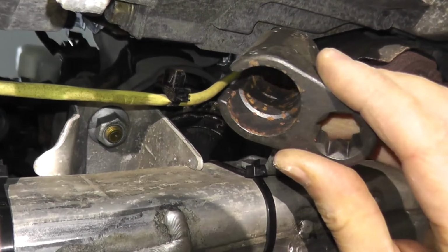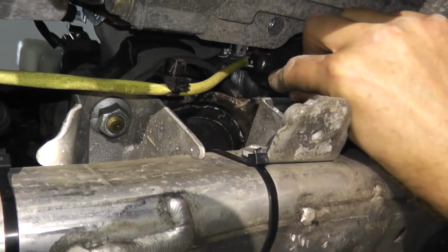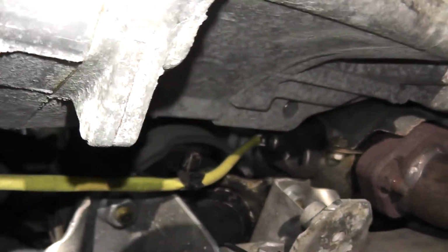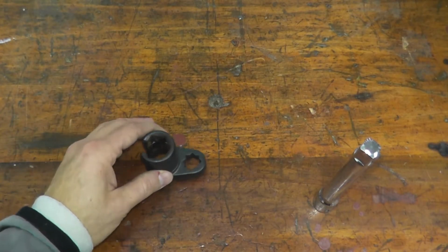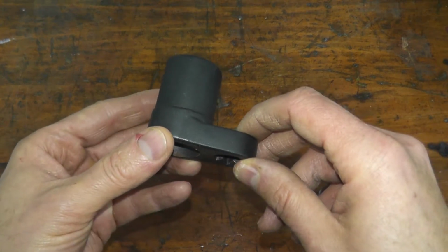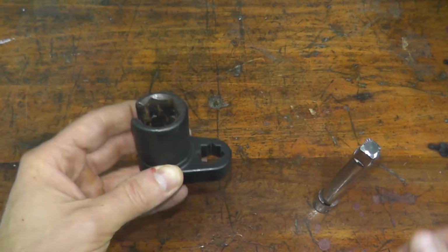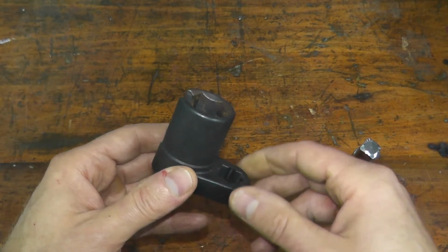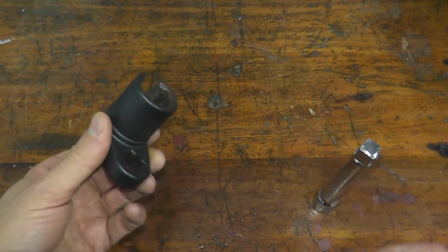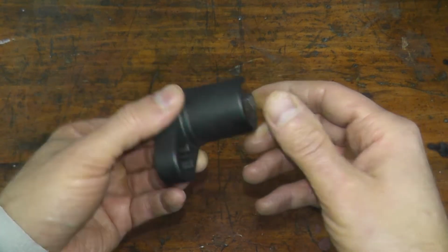But nonetheless, once you're ready to go, grab your sensor removal tool. These are 7/8 of an inch, if you're curious. Let me grab an extension and we'll get this off. Now this is an oxygen sensor removal socket. It makes it very, very easy removing these sensors from the exhaust. Ultimately, you can rent one of these from your local auto parts store, or you can just purchase one. This is $9 off Amazon. I'll include a link in the description box below directly to Amazon if you do want to purchase one of these. But ultimately, this just simply fits over the sensor and you just remove it.